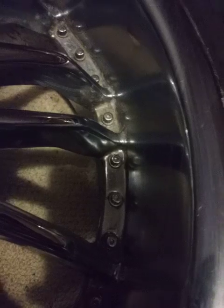So, you take that Mother's and Neverdull and rub all the insides, everything. You rub the inside of your chrome. What it's gonna do, it's gonna leave a real nice fog on there, kind of like a wax. But it's gonna be easier to come off than wax. And you can wax them after all this.